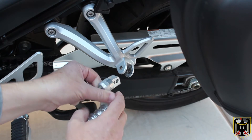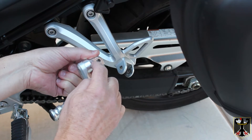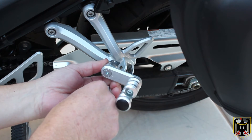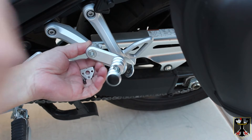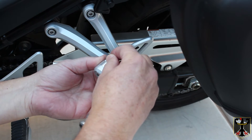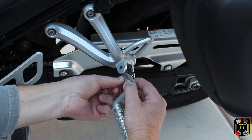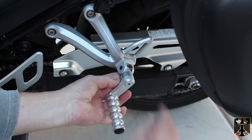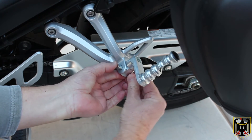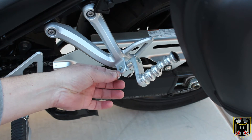The first thing we're going to do is install this piece here. The detent piece or the spring piece goes towards the back. You could take this off if you wish to make it easier to install — make sure you wear your safety glasses. Put the little spring in here and the little ball that goes against the detent plate, then the detent plate goes in like this. Squeeze it tight, put it in, then put the pin in, flip it up to get it in, and then put the e-ring or c-clip on the back side.